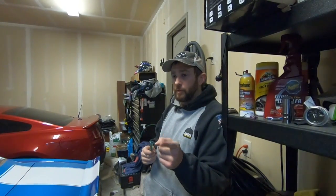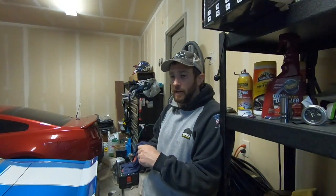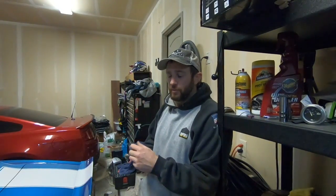The other thing I want to do is show you the Nova, so that video should be coming out after this one, too. We've already done the work. I need to actually start it. Yeah, film it. Definitely. We put the battery in. We ran some new wires. We got an ignition switch. We put in our own hidden kill switch. It should be ready to roll because before it wouldn't keep running.